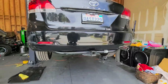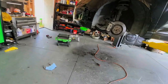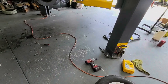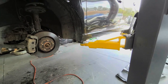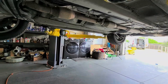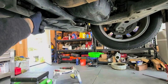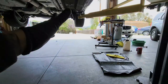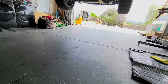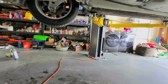I already started a little bit — I just took off the tire and got it leveled up. You need to have the car literally leveled; you cannot have it tilted at all. I'm going to show you the jacking spots. You can jack up the front right here where this little notch is, but make sure you have your emergency brake on and you're on a level surface — not on a hill — because the car will either roll back or you'll get a misreading on the transmission during the service.